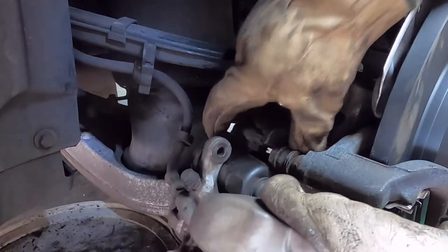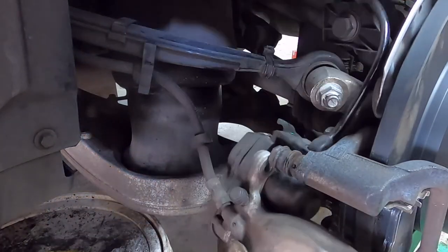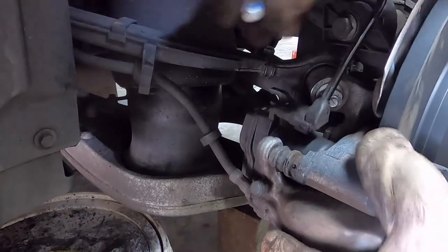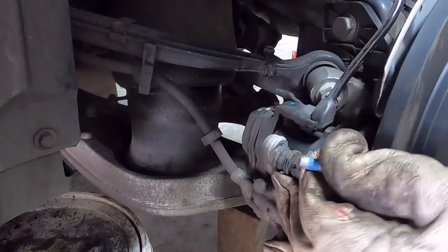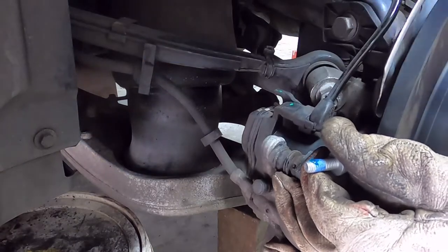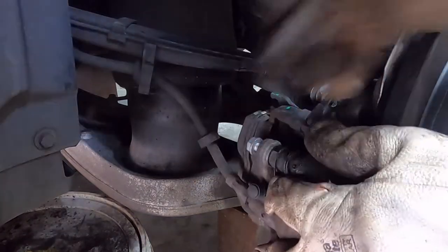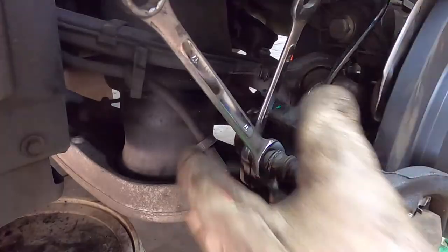Anyway, okay, caliper. Go back on over the new pads. It's a bit fiddly, you've got to put the top edge in first, get it over the pads, and then new bolts. Hold on, like this. Bit of thread lock. The new bolts got thread lock on anyway. New bolt in there. I'll just get that tightened up. GoPro, stop recording.